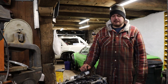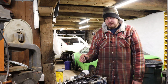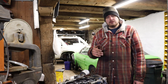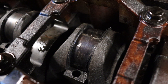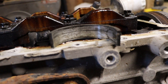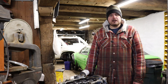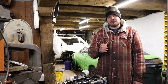All right ladies and gentlemen, we have spun bearings. Not what I was hoping to find, but that's what you get for such a cheap engine. It's very likely this had an oil starvation issue of some sort. My dad just told me that the previous owner told him they forgot to put oil in it after an oil change — that would definitely have caused this failure. You can see one rod bearing is just completely gone, there's nothing left, and the bearing next to it is spun. It looks like it was starting to tear up the main bearings too. Basically most of the parts in this engine are junk, but it's still going to serve as an excellent mock-up motor and we'll still get our money's worth out of this by selling the transmission. Make sure you like and subscribe and we'll see you in the next one.